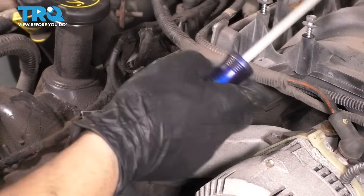If you look closely, you can see right there, it says cold fill on the reservoir. That's exactly where you want to fill it up to. If you put a flashlight either in the tank or to the side of it, you'll see the coolant line, the level. And just make sure you don't go past it unless you are actively trying to bleed it in your funnel here. So I actually filled mine right up to that fill mark.